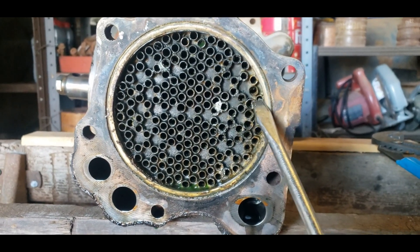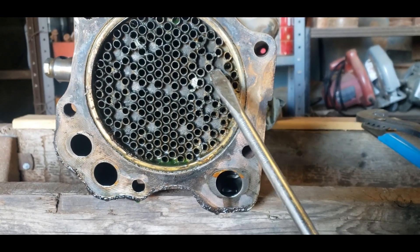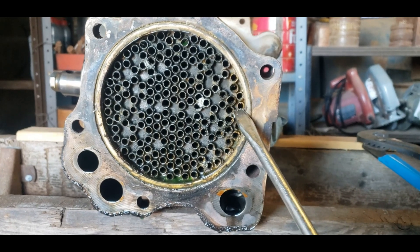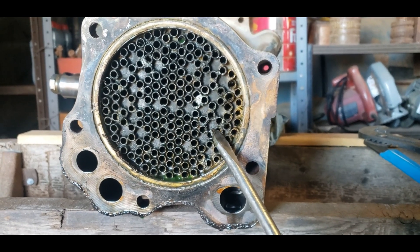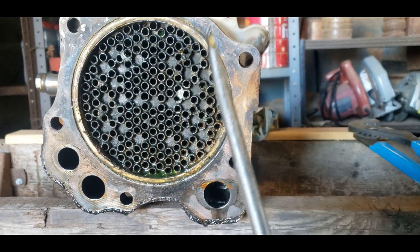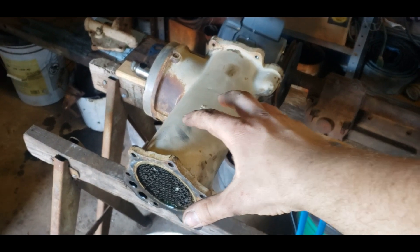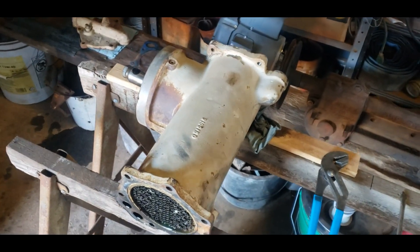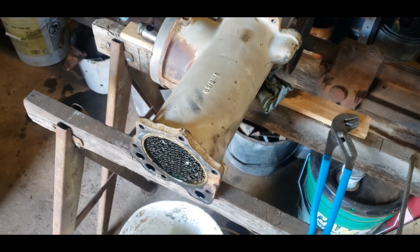This core doesn't look shot — it appears to be in good shape. But I went ahead and got another one anyway: if it's actually bad, we've got a new one; if it's not bad but I screw it up getting it out, we've got a backup on standby. This is what your oil cooler core and housing looks like. It's quite heavy and it's going to be dripping with coolant and oil when you pull it off. You can go take a shower afterward — many people have had worse put on them and lived.